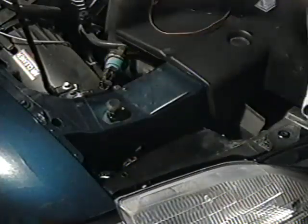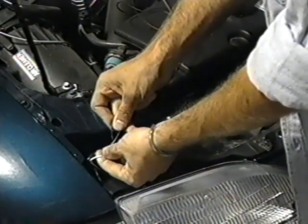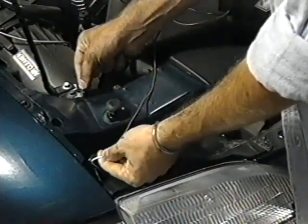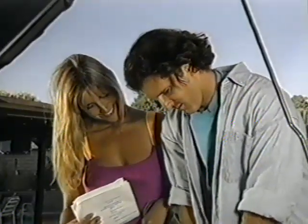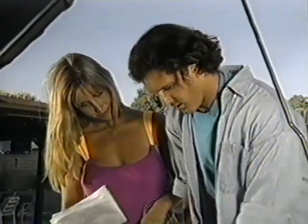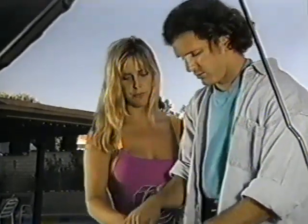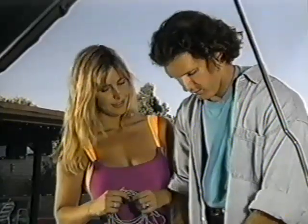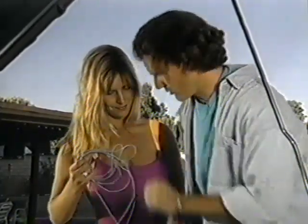And what about the red? Then the remaining red wire hooks to the hot lead of the back of the parking lights. Okay. That's this white wire. It's a running light. It means it goes on when the headlights go on. Okay. Now what about these two yellow wires? We're going to hook those up to the power wire, which runs through the car to the back. Oh, okay. All right. Then we'll just feed this through to the door, okay?